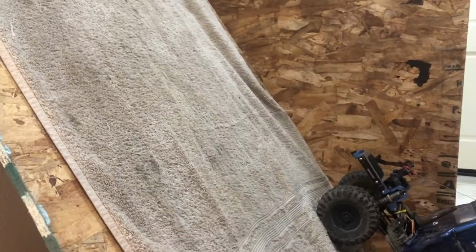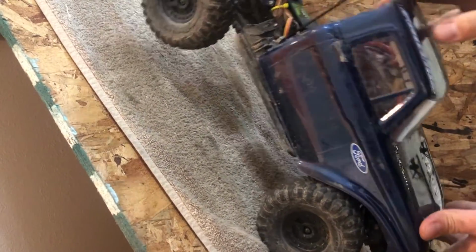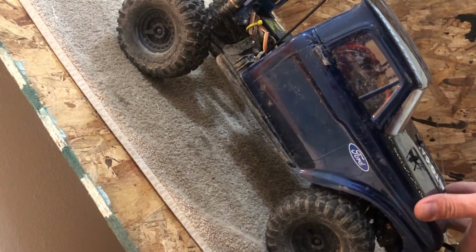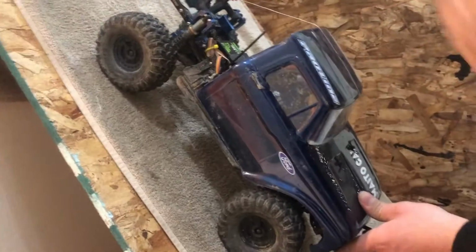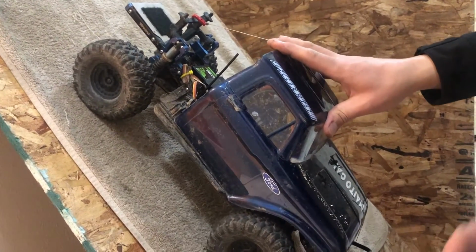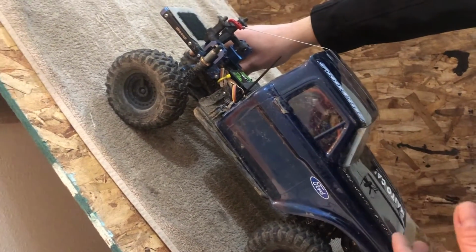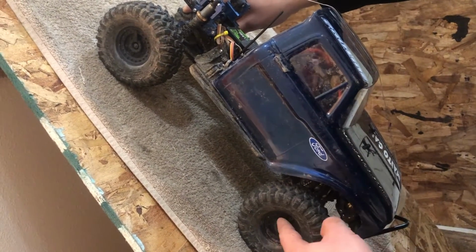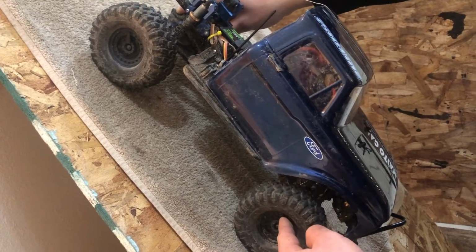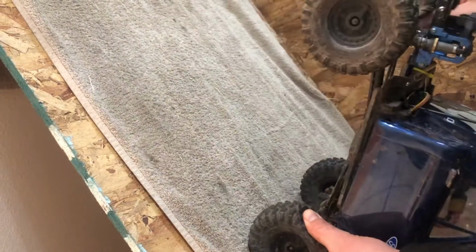But where you put the mass matters. So this is very heavy up here on the front, in front of the fulcrum. It's going to want to flip over, even though there's a lot of weight back here. But because there's so much weight, and some of this weight is actually just counterbalancing the other additional weight, you need to work your motor more. And if you're making your motor work more, your motor is applying more torque to the drivetrain, which ultimately translates to the wheels. So if the wheels have to apply more torque, going in reverse, things are gonna topple over.